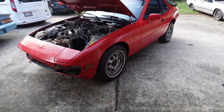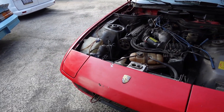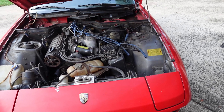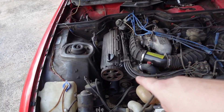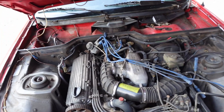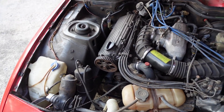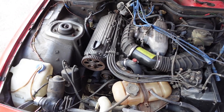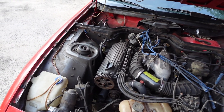What's up, got another video. I'm going strong on this thing — I got a bunch of parts for it. I'm waiting for stuff in the mail to do the ITB swap, still waiting for my intake manifold I ordered, and timing stuff, basic tune-up. I'll have to get a fuel pump — from the videos I've watched, the stock fuel pumps put out too much fuel pressure. You can run a regulator but they still put out too much, so I'll get a small 5 PSI fuel pump or a motorcycle fuel pump.